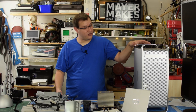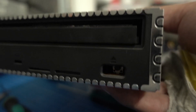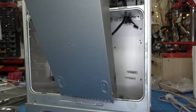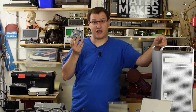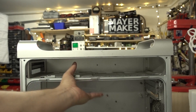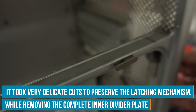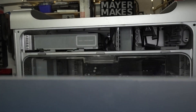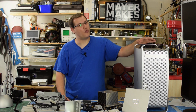There are a lot of interesting design choices about this case. A lot of parts are user-removable without the need of any tools — you can just pull out the HDD, for example. But there are also parts that are not replaceable at all; you need to cut open the case to get them out. There's a fan at the top of the case that is not replaceable without destroying the case — the manufacturer just tells you to buy a new case. A feature I want to preserve at any cost is the latching mechanism for the side panel. It has a little lever on the back; if you pull that, the panel comes off beautifully, and if you want to put it back, you just push the lever in and it's locked. That's a really great design and I want to keep that no matter what.